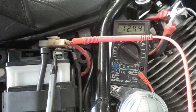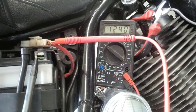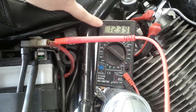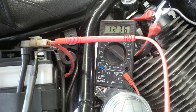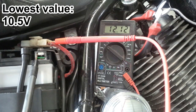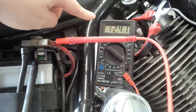I also should open my fuel tap — so let's try this again with the fuel tap open. There's only 0.15 volts difference. The ignition circuit and instrument lights are consuming a little bit of battery power and it slowly goes down, but it should still be enough to start the bike up. Now we have to keep an eye on that multimeter while pressing the start button. We could see that the voltage went down to about 10.5 volts, so it lost about two and a half volts while cranking.